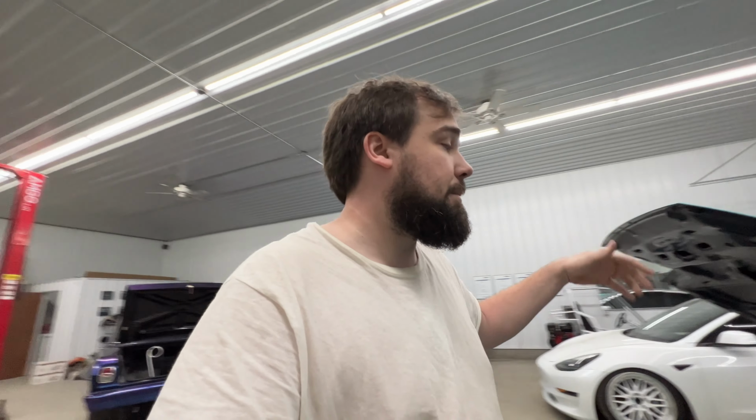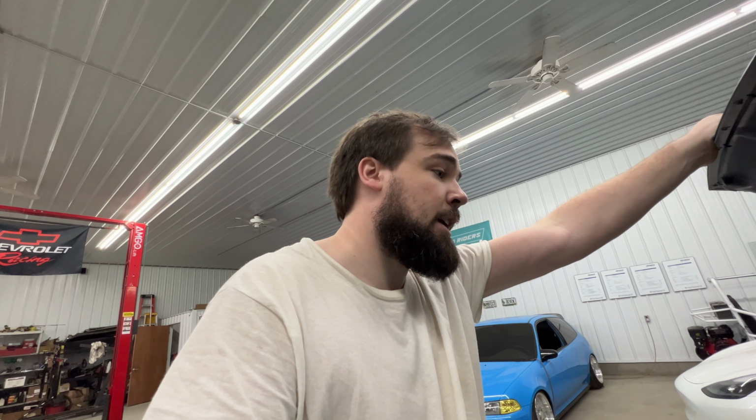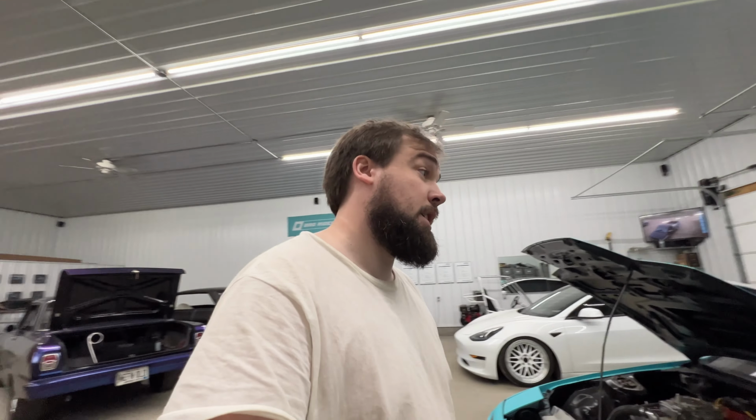That wasn't the solution. So as I was saying in the car, I think I'm just going to jump up to whatever jet size I need for it to run right. The cam in the engine is a lot beefier now than it ever was, and a 600 for it is probably pretty small. So if we can just open up the fuel limitation, I think that'll solve the problem, being we had drilled out jets in the carburetor before and this issue wasn't here.